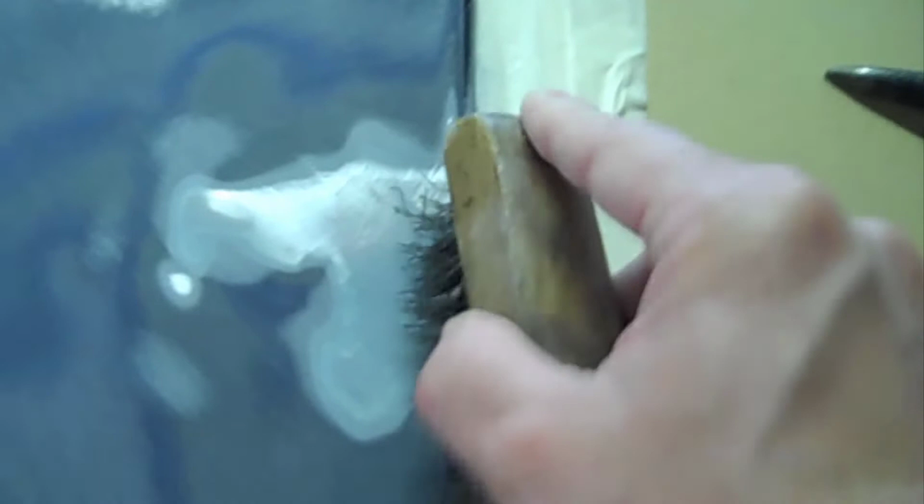So if you want a good strong edge, and then, like I said, it's low, and the sandpaper didn't get down in there to that low, so I use a wire brush and kind of sand the low spot. Let me get in there to the spot the sandpaper couldn't get into. That way, the body filler, when I put it on there, it's going to adhere.